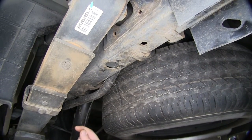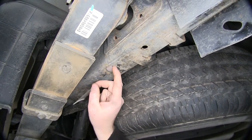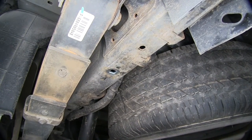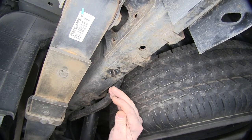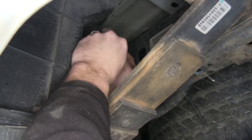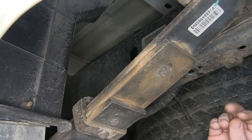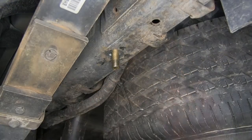We'll pull the fish wire through until we get it over the hole. Once we get it over the hole, we'll pull the fish wire out and invert it so the coil goes out through our block and out the access hole. Once we're out the access hole, we'll go ahead and thread on that carriage bolt. Slide it into the frame rail and pull it through the mounting location.